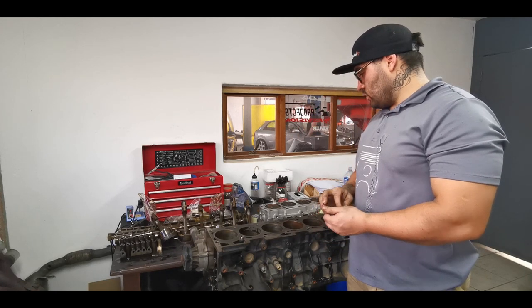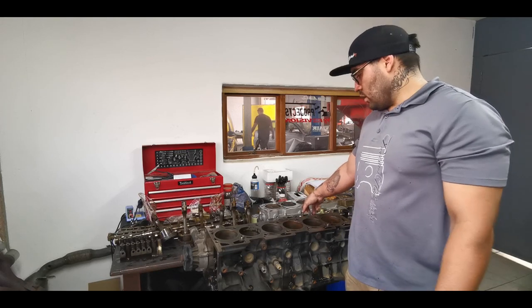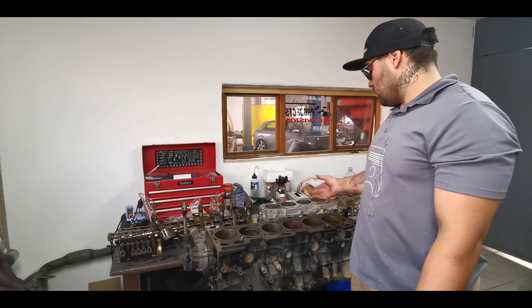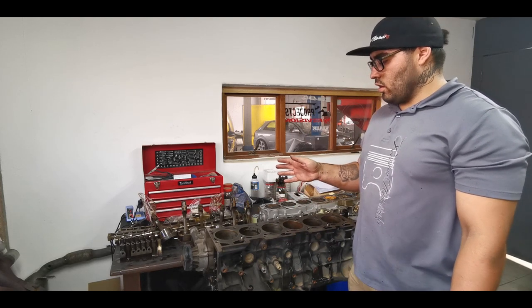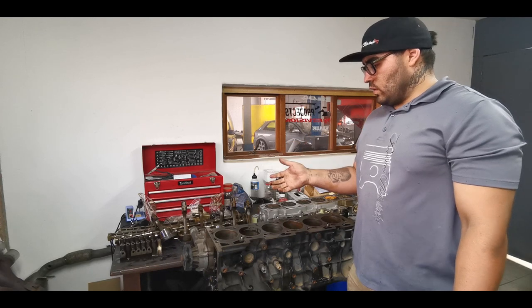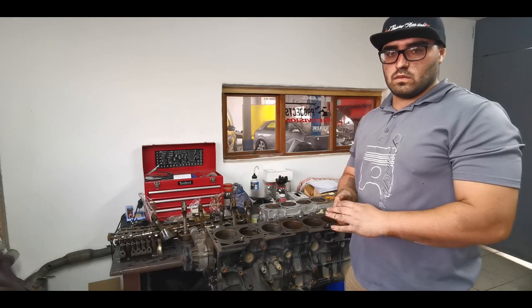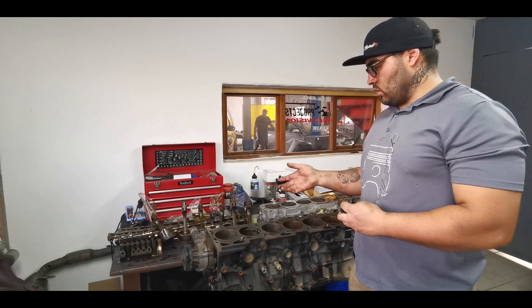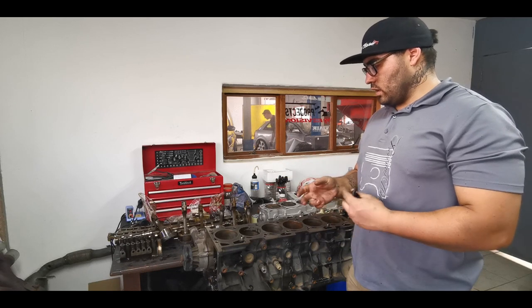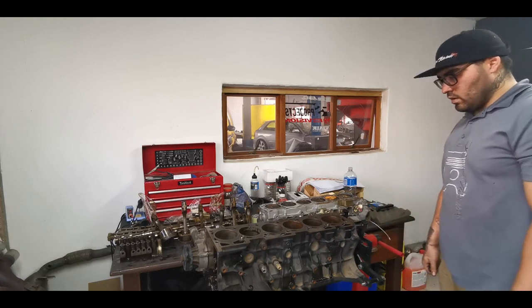And yeah, we're going to send the head in to get decked, skimmed. I'll remove all the valves, all that kind of stuff. And we're going to chat to the owner, see what's going to happen with the pistons and all that, what pistons we're going to use, and all the rest of the stuff, all the bearings, all that kind of stuff replaced. And yeah, thanks for watching, guys.